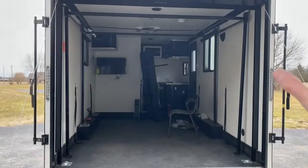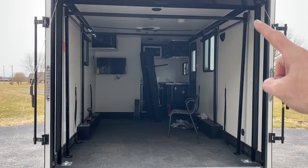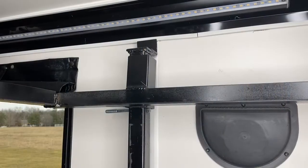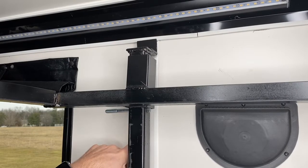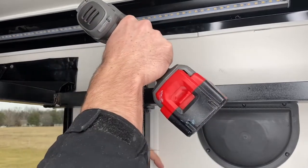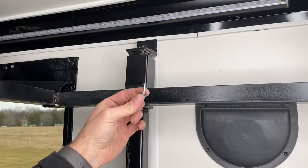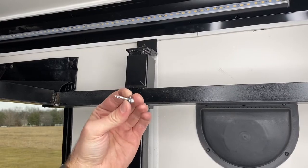The time has come to move my bed frame into the trailer - this part's probably going to be a little bit bulky and awkward, so I'm probably going to movie magic this part. That was right - that was incredibly awkward and difficult to get in there. Now we're going to screw in the top on both sides, and that should line the posts up where we can screw them in at the bottom. We're attaching the rails where there's a steel stud running down inside the wall - you can tell because that's where the screws are - and we're going to pre-drill our hole and use self-tapping metal screws, like sheet metal roofing screws.